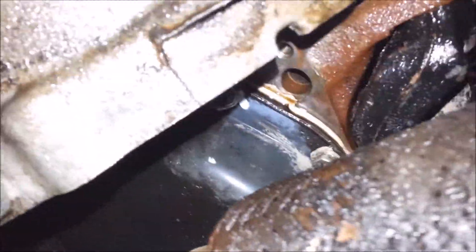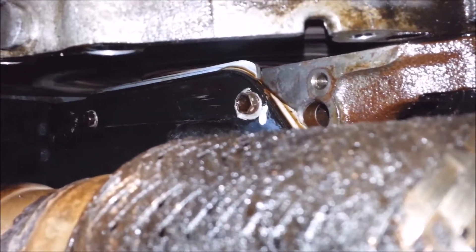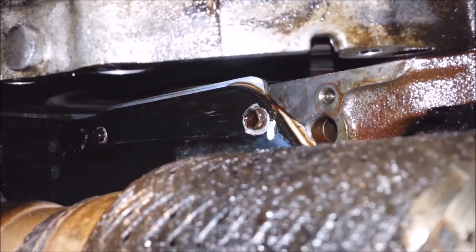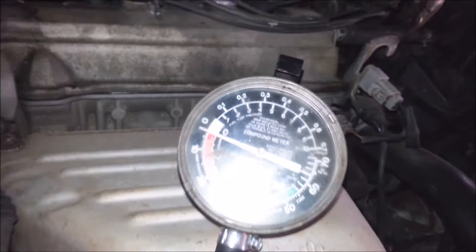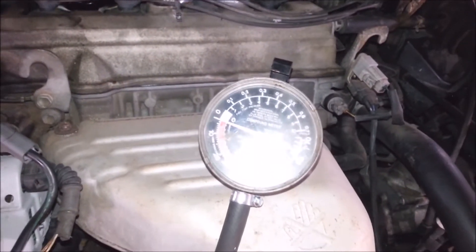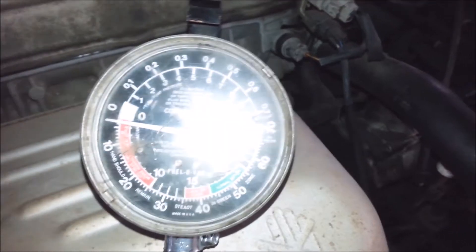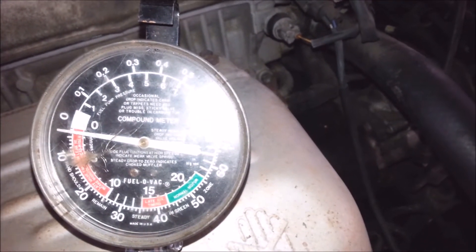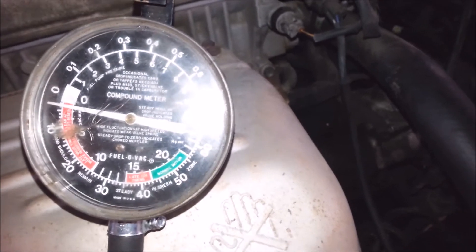It's pushing it out of there. It's looking like you've got an oil pan leaking. You can see it's leaking right in between that aluminum cover and the block. It's amazing what a little bit of pressure can do - it pushes it right out. It's not even a quarter pound, as you can see that's what the gauge is reading with the engine off. So it was pressurized, just not a lot. It doesn't take much and you can find a leak real quick.